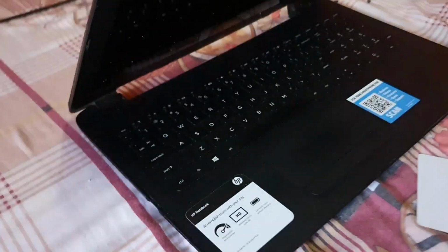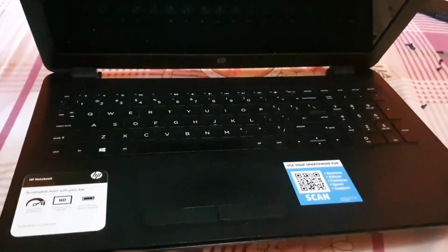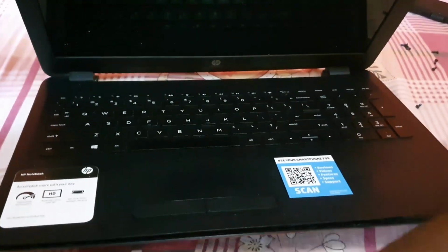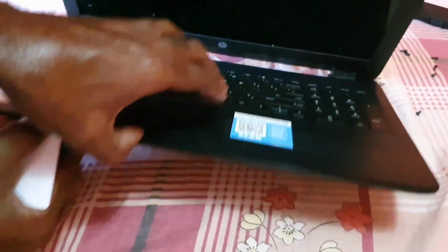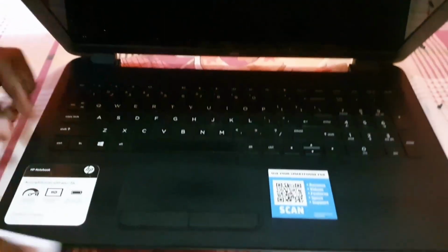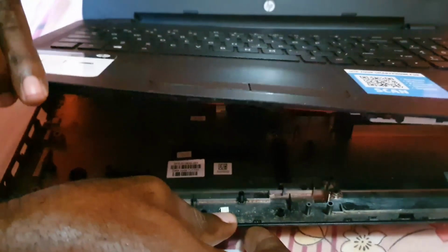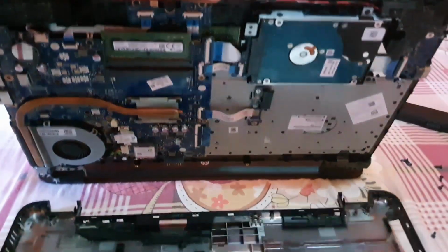Alright, I'll try to do this right here. Alright guys, so I got some assistance. As I was saying, in this section, make sure that you get the card in between here to lift. I've already pre-lifted this. It's not very hard. Simply get it into the grooves. It will lift all the way around. And you want to get the screen out of the way. Once everything is pre-lifted, you're going to carefully separate the back.